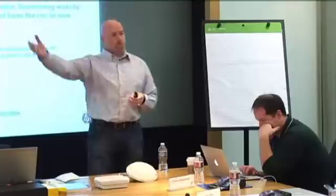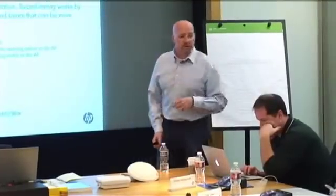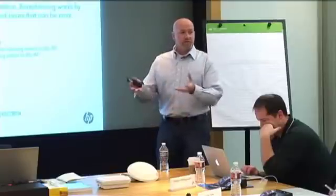And what's nice about HP then, if you implemented these 466 products, if you have them in the overhead, then you can turn on the second radio to 5 gigahertz, which takes care of that issue and gets you quite a few years ahead. So we're already pre-planning for it. You have your 2.4, and once the advent of 5 gig is here for everybody, shut down your 2.4 and bring it up to the 5 gig on both radios. You've got 900 megabits now in your cell.